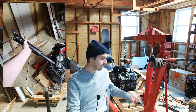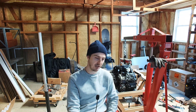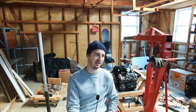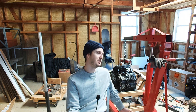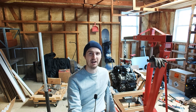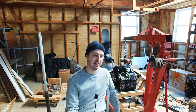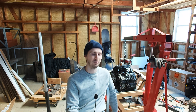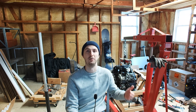I've got the driveshaft here. I'm going to cut the yoke off and get a flange on there to mount to the flexible coupling. That's not a scalable solution, but it is a good solution for one prototype. In the future I'll have to figure out what kind of spline that is. Also, this whole mock-up is a lot stronger than I thought it would be — it's been supporting the engine nicely with just plastic mounts. It was flexing a little, but that's just the jack from Tractor Supply sagging a bit. Nothing was broken, so I'll straighten that back up and get the front engine mounts figured out.